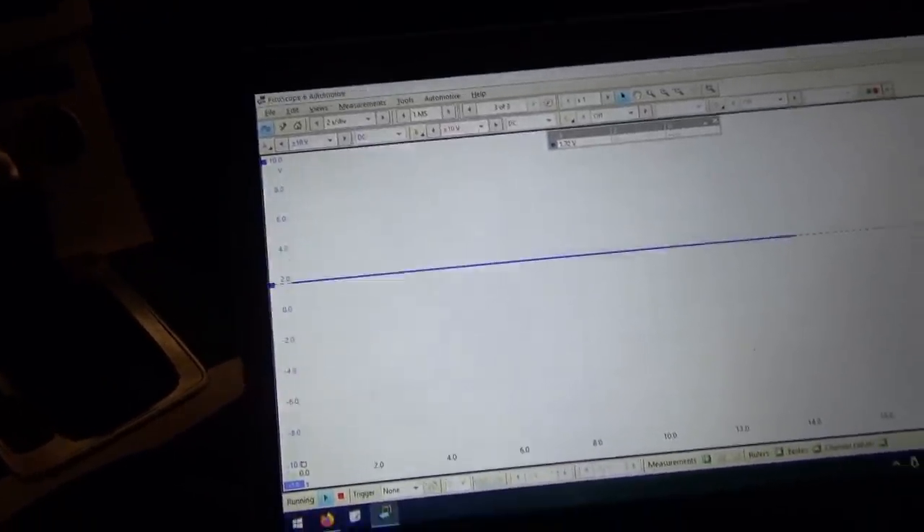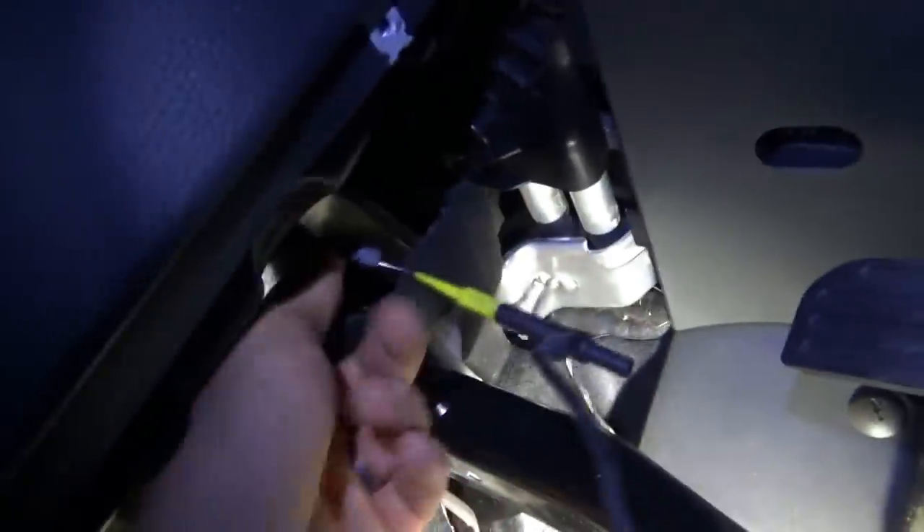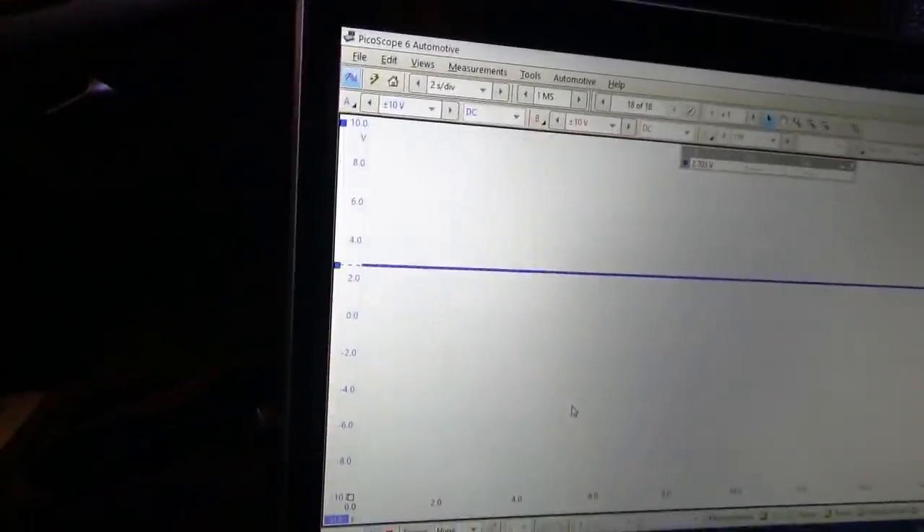We can't talk to this interface. I located the data bus diagnostic interface - it's a small black box that lives above the brake pedal. There's the connector with a red and white wire - that should be power. Sliding off the blue clip to access the wires. Interestingly, on pins 6 and 14 now we're up to about 2.7 volts. That doesn't make sense - if we disconnect the data bus the wires should just go to zero. Something's not adding up.